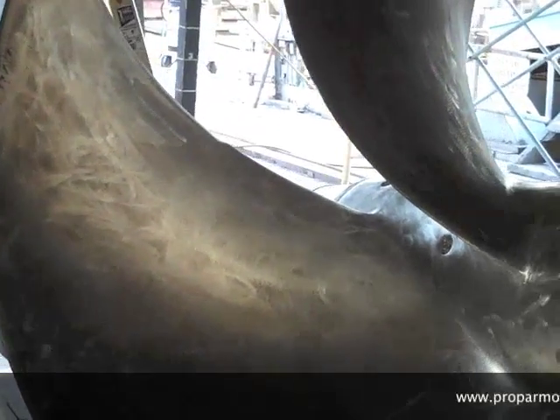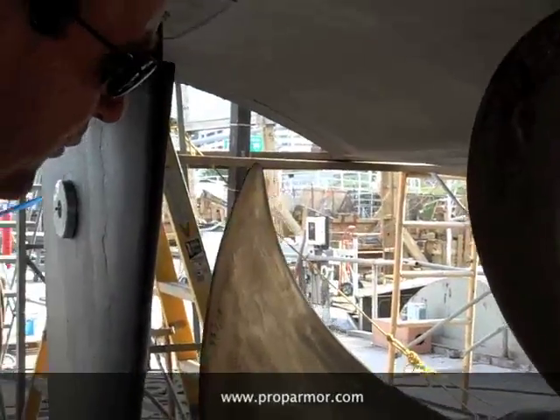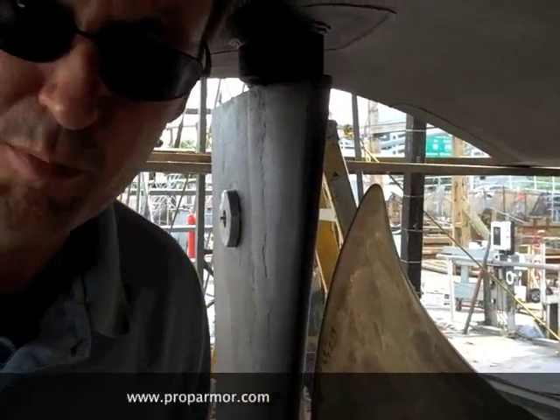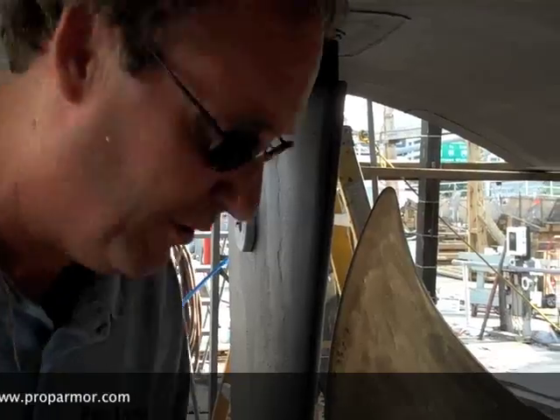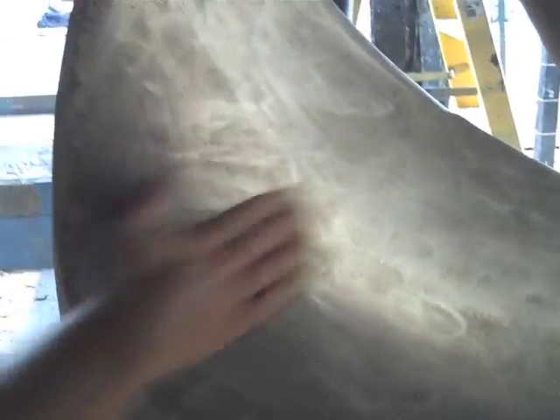So we're going to take a brief pause here and get our sandpaper ready to sand, and we'll do a quick demonstration with that. We're back live again and we're about to sand our prop. We've already actually prepared this prop, but I'm just going to give a brief demonstration on what we're looking for when you prepare the prop. Just take your 80-grit sandpaper, start working it into the prop, so you get a nice rough keyed finish. That's going to ensure that we have good adhesion of the product when we finally put it on.